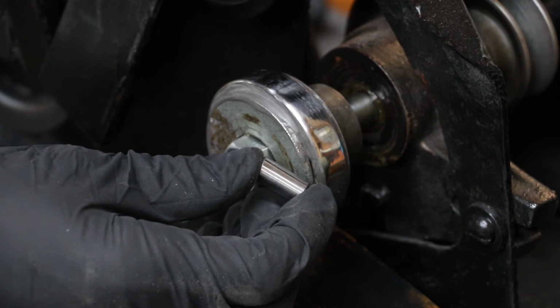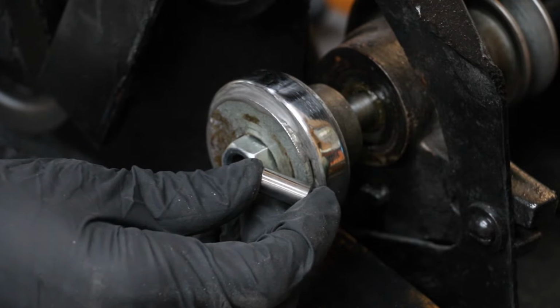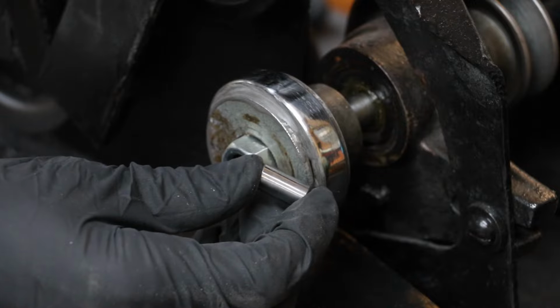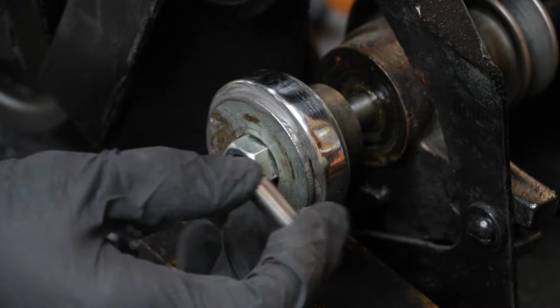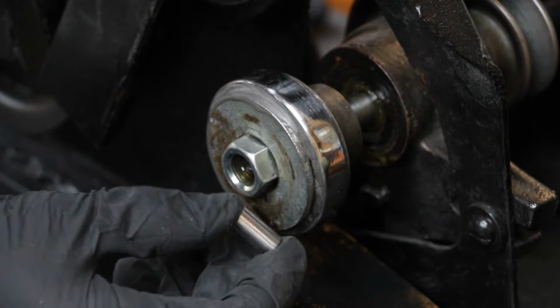You guys have given me some great suggestions on how to improve the test design of the lubricity tester itself. So what I'm going to do, instead of using an abrasive wheel, I'll be using 1500 grit, which essentially cleans and polishes the bearing race itself. This is great advice, so thank you for that advice.